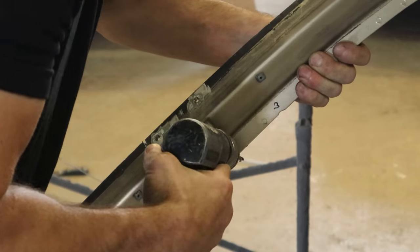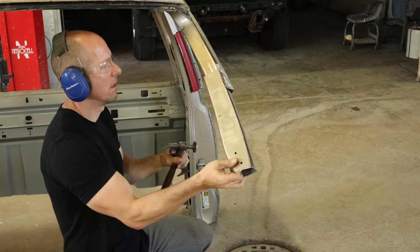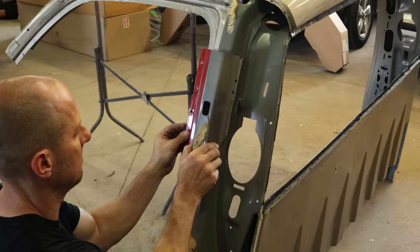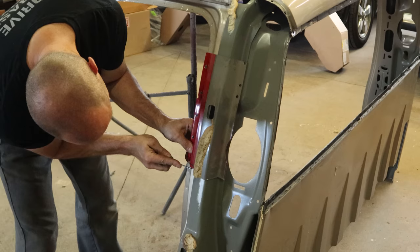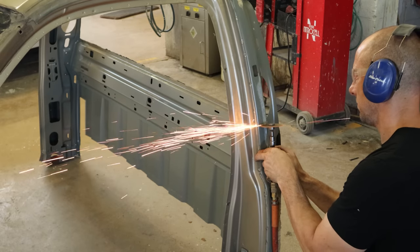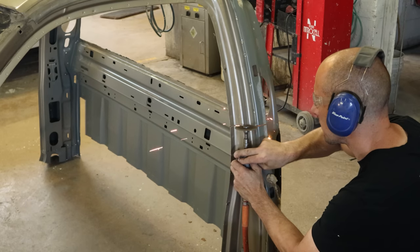We'll drill them with our 1/8 inch bit first, and then go over them with our 5/16. We'll knock everything loose — didn't take much to get this piece off of there. Now we're going to use our template on the back here — we're going to scribe this outer panel. We're putting this one in a little higher. There's no reason to drill all the lower spot welds off and replace it because our piece wasn't bent at the bottom. This side was pretty much only bent at the top, so we're only going to replace that — it's a little bit less work, that's why we're doing it in two different locations.